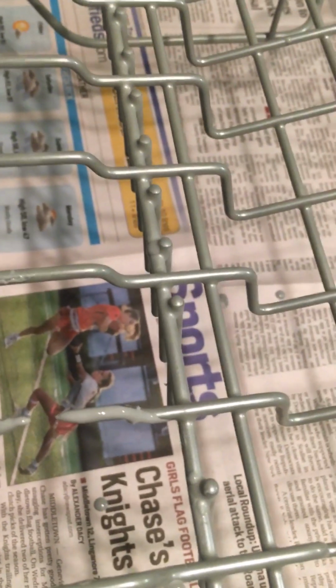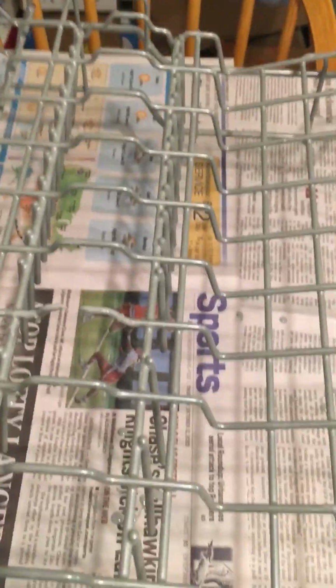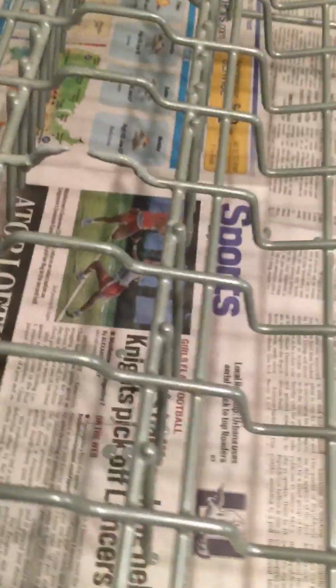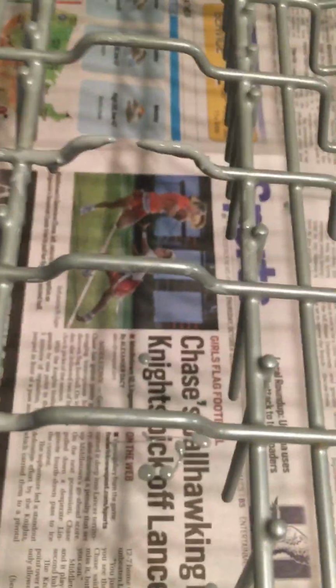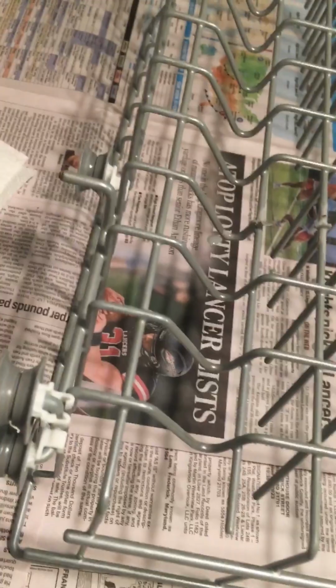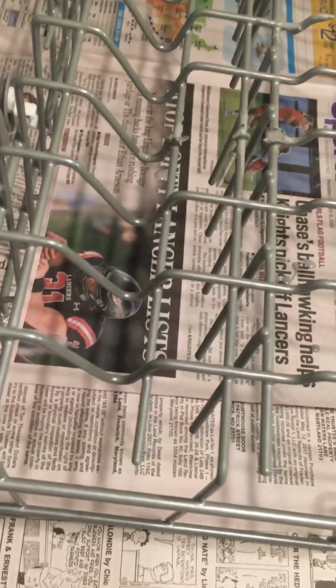What would be ideal, you have to go without your dishwasher for a while, is to put on 2 coats. Giant thick coats of any coating, real thick coats, is not advisable at all. Any coating manufacturer will tell you multiple coats. Always go with multiple coats versus trying to go one thick coat. Coatings don't work well that way. You'll get alligatoring and all kinds of dripping. Multiple coats is always better. Same thing with stain on a deck. You want 2 coats. Don't try to get away with 1 coat.